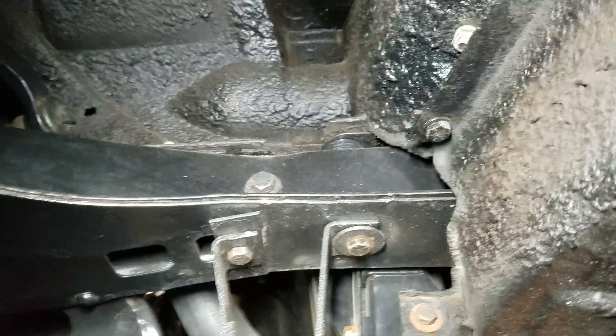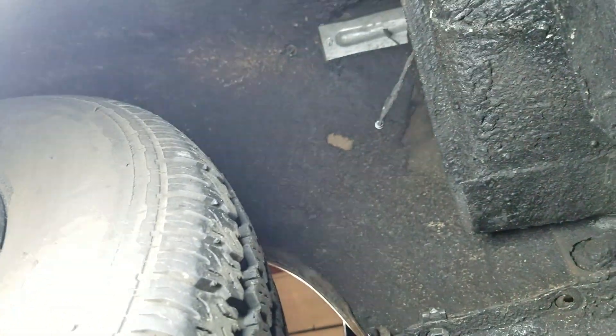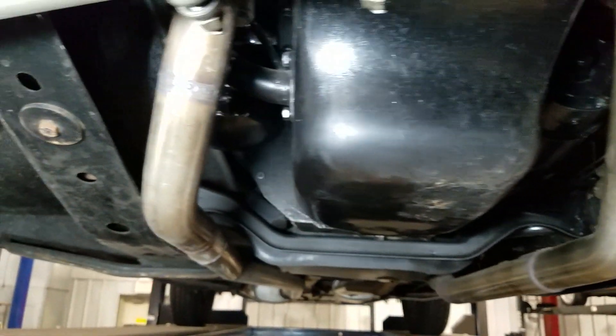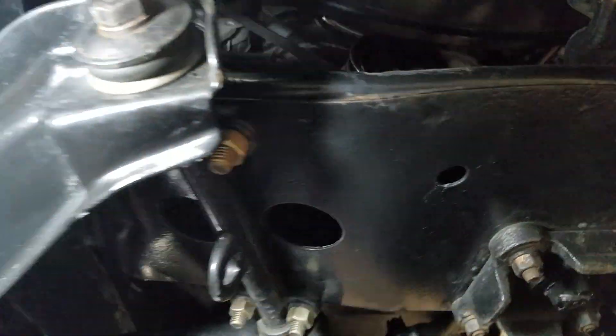Back up here on the frame rail extensions — no ripping or compression or tears. No evidence of accident damage that I can see. The inner wheel and back sides of the fenders — everything's been undercoated, heavily undercoated. Everything seems well preserved. I knocked on it with my fist. Structure-wise, the splashes are in really good shape. Detail up here on the front of the motor — we've got a new fuel pump, new belts, new castle nuts on the pitman arm. Everything looks like it was taken apart and serviced.